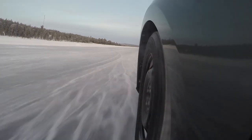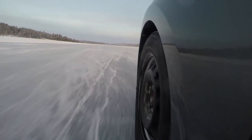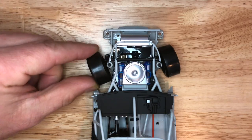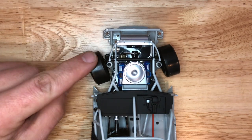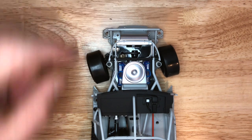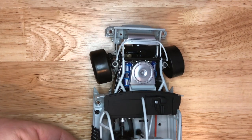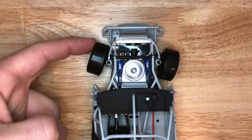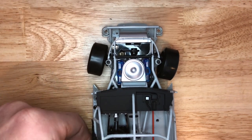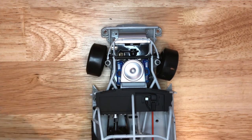In most cases, when we load the side of the failing wheel bearing, the noise will get louder. When we unload it, the noise will get quieter. So if we suspect a left front wheel bearing failure and we turn the vehicle slightly to the left while it's making the noise, if the noise goes away, we've unloaded that corner of the suspension. If we were to turn the vehicle to the right slightly, we're loading that left side and making the noise louder.